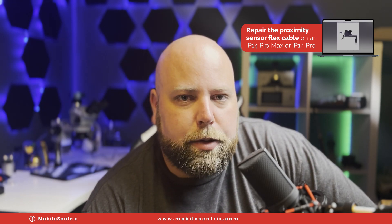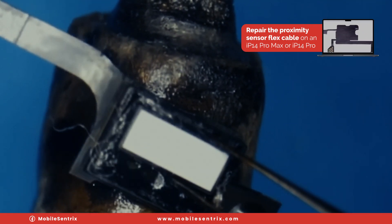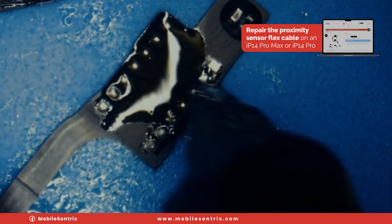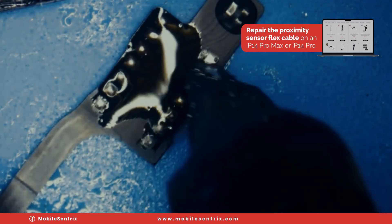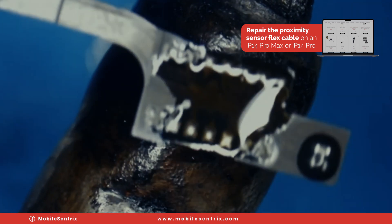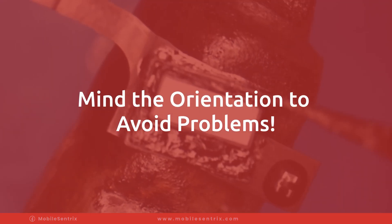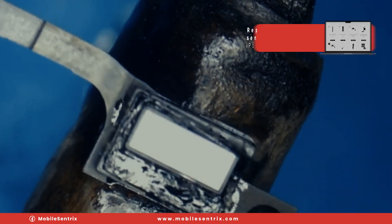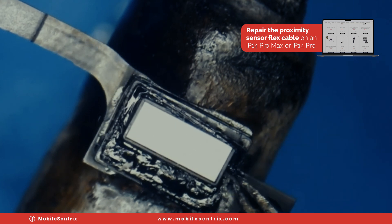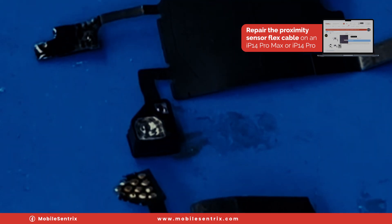Soldering over the ambient light sensor does require a little bit more skill, because you'll want to make sure you have the proper amount of solder — either reballed using a stencil onto the sensor itself, or you've honed in the amount of solder you leave on it without a stencil and on the flex, so that you can get a proper solder keeping proper orientation. It's all quite critical, but it is fairly simple. So if you've run into this issue where you've damaged the prox or it's been damaged and you need to replace it, it is that simple. You don't need crazy soldering skills to do this.